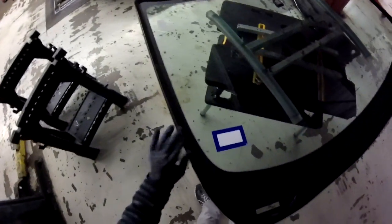All those clips and hooks that go inside, you have to take them off. Don't leave anything inside. Okay, so you see, no damage. So we pull the glass without breaking it. Now, what I like in this kind of job is that I'm gonna use my razor blade and just clean all the urethane, okay? Under this one you're still gonna have some urethane on the glass. That's good, because remember, you cannot use primer again.